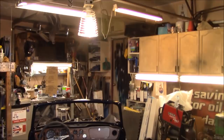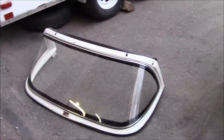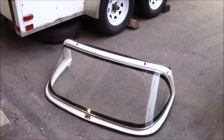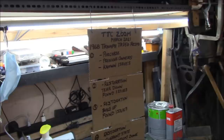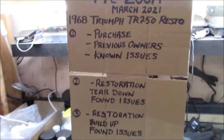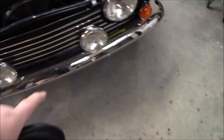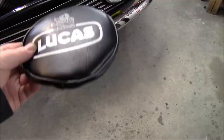We're going to back the car out of the garage a little, make a work area in the corner, and start sanding and doing body work. The intent is to fix what needs fixing, sand it down to 400 grit, put it in a coat of black epoxy sealer, then base coat and clear coat. Should be a warm day tomorrow — about 19 degrees Celsius — so a good day to paint if I can get this prepped. Last night I had a Zoom meeting with my local Toronto Triumph Club and covered the restoration of my '68 TR250. I also received a gift of some Lucas covers for my spotlights from club member John, who watches my channel. Elin dropped them off this afternoon — they're going to look fantastic on the front of the car, so thanks very much John.